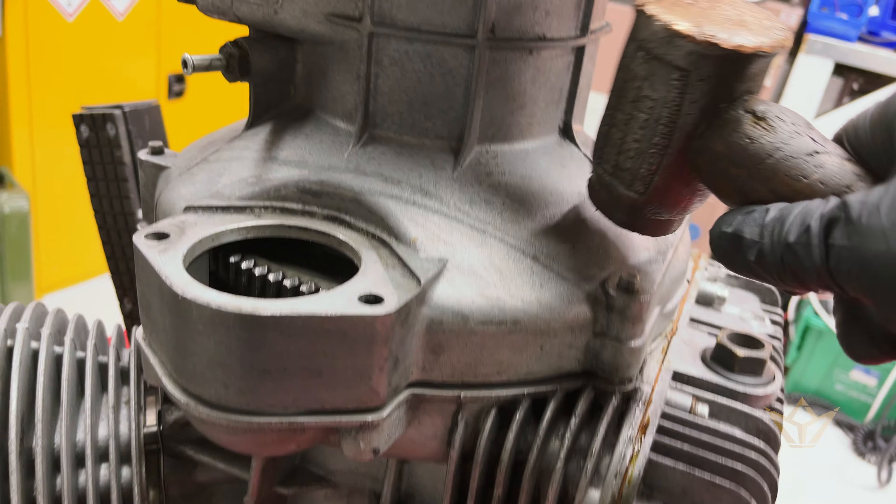You can just tap it down with a leather mallet — something really soft — or just jiggle it, and the weight of the gearbox will hopefully push those plates centered. I had the outer plate correct first time around, but the second one was jamming. So once I knew the outer was centered to the gear, I took it out and with a hammer and screwdriver just tapped that second gear tooth into alignment as close as I could get it. With a bit of jiggling I managed to get the gearbox on, then took it out and tightened up the bolts. Bear in mind that once the engine is running, those plates will center 100% perfectly, so don't worry too much — you can do it without the alignment tool.